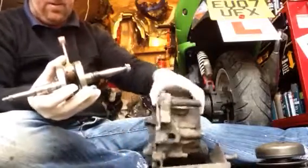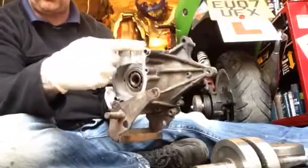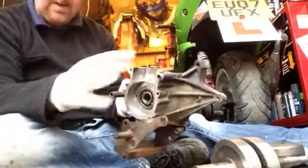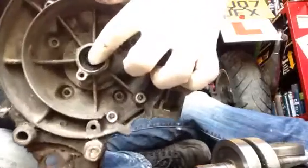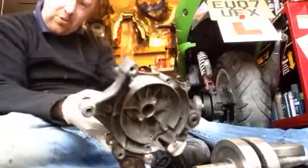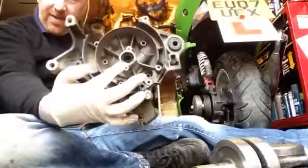And now you're wondering how to get this onto the other side of the engine. Obviously no nut. Now what I always do - gasket goes on here, and you wonder what a gasket's sealed across the top, that just cuts away. Gasket goes on here. Water-cooled is slightly different with gaskets, but generally the same. And this is what you'll be seeing - this is the main bearings, your engine bearings. And then the other side, just that little black bit there is your oil seal. That's what goes - that's when you lose compression on the bike and you kick it over, it's not sucking the petrol through. It's because of that little fella there.